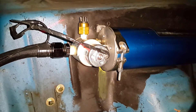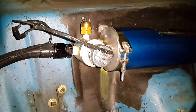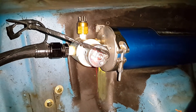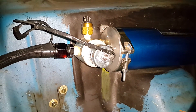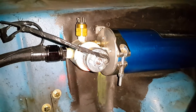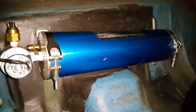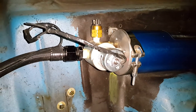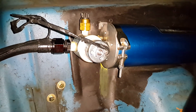How it's set up when it's wired directly like this is just like a manual valve, but I just have an electric switch up front that actuates everything. If you set yours up like that, Hoodstig, you should be good. Just use an AN-12 if you relocate your AccuSump to the rear. The valve side is slightly higher than the gauge side, so make note of that when you're mounting it. Just use an AN-12 steel braided hose and you should be good.